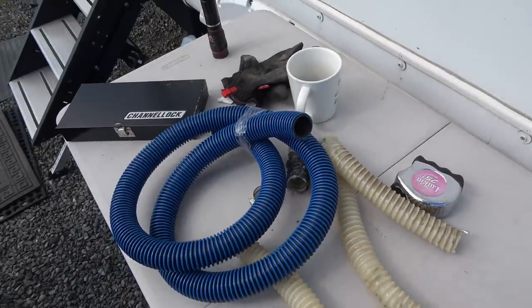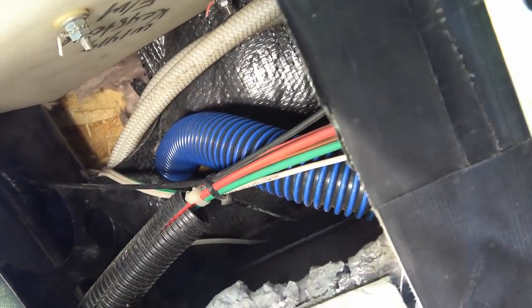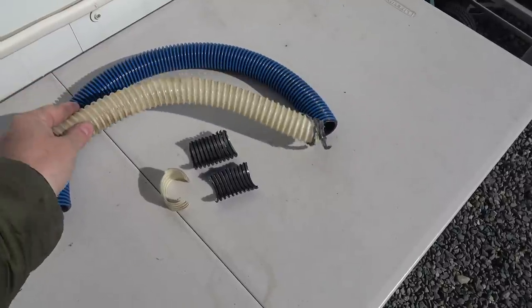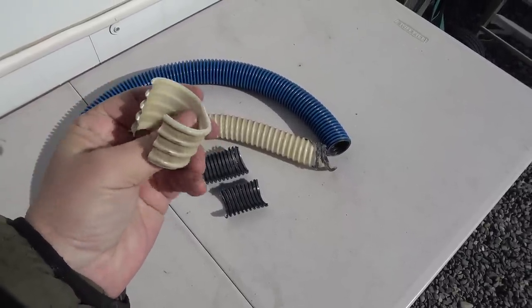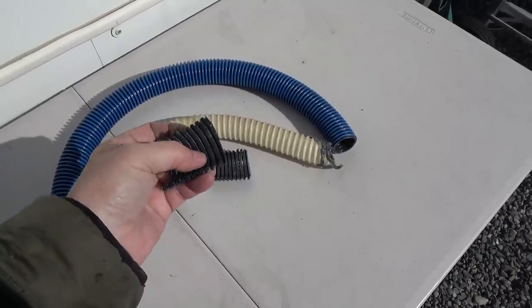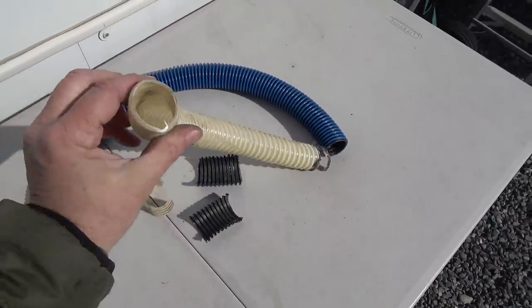We'll put that in, hook it up, and see if we have any leaks. It took a little bit of effort but I managed to get the hose back threaded down. Keystone had cut a hole in the flooring and that's where they ran this fill pipe, along with the water pipes, the vent pipe, and pickup pipe. Well, there's a hitch in my cunning plan to use the pool hose — turns out this is a pool vacuum hose, which is a little different. The inside is smooth on the RV hose but this one is corrugated inside, so when you clamp it down it was weeping ever so slightly. In the meantime I filled in the grooves with some silicone, tightened it up with hose clamps, and it's not leaking, but down the road I'm going to have to get some of the proper stuff.